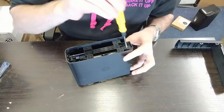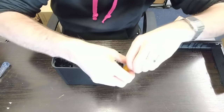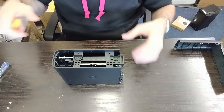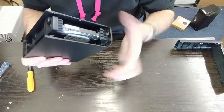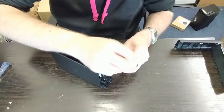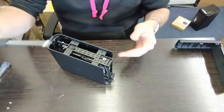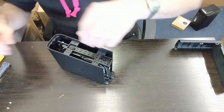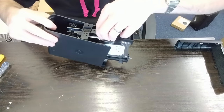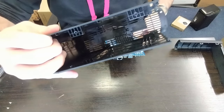Remove the screw coming in at an angle. Synology have clearly decided that a closed chassis architecture is beneficial — not only for simplicity and keeping everything in one place, but also for securing the drive. The first two screws on that side are now removed. Moving to the final screw on the other side — once removed, the internal assembly is only held in place by a series of hooks and will lift out quite easily. Be very delicate as you move to avoid scratching the internal motherboard on the inside of the casing.